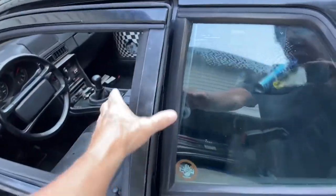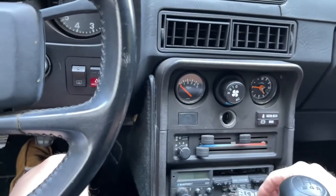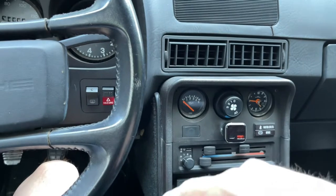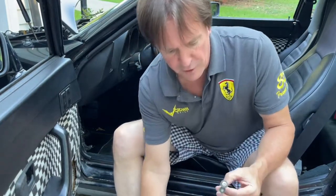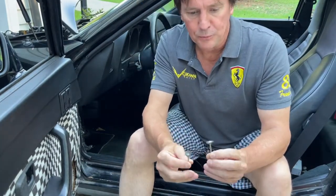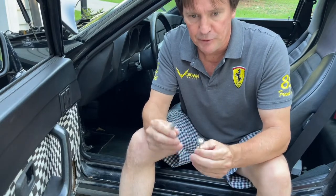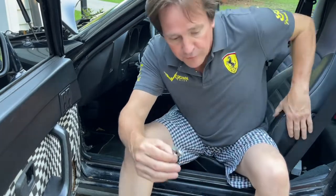So what are we doing today? I've got the battery disconnected. I just got in here with a drill and a mini wire brush and cleaned up the cigarette holder, which I would never use. I got a voltmeter reading 13.8 volts, so we know the alternator is putting out and the battery is good and charged. Now I'm going to get up underneath here and drop the upper fuse box out — it's the only one I haven't really cleaned up. I've got a wall drill and two Dremel wire brush bits. I'm going to drop that fuse panel out, clean up all the contacts, inspect the fuses, and probably swap some of them out.